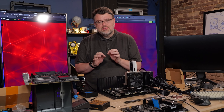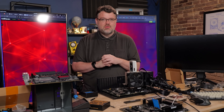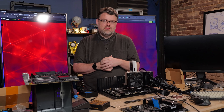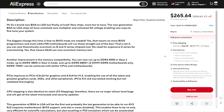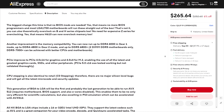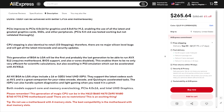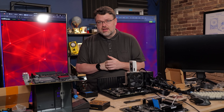Another potentially exciting side feature: if you disable all your E cores, you do actually get AVX-512. These are 13th gen CPUs that don't seem to have AVX-512 functionality fused off. So if you really needed 8 P cores of AVX-512 for some unruly experiment — like does the CPU destroy itself even quicker under AVX-512 workloads — these are great CPUs for testing that.